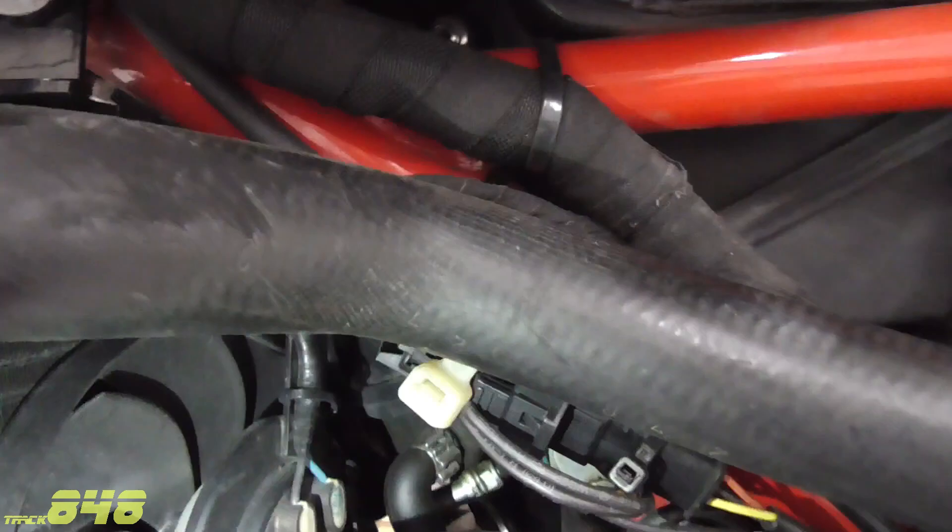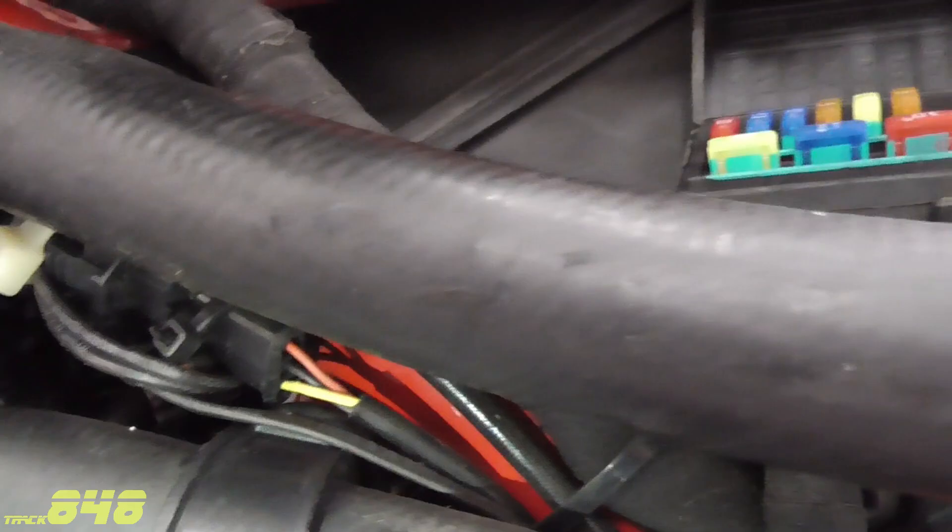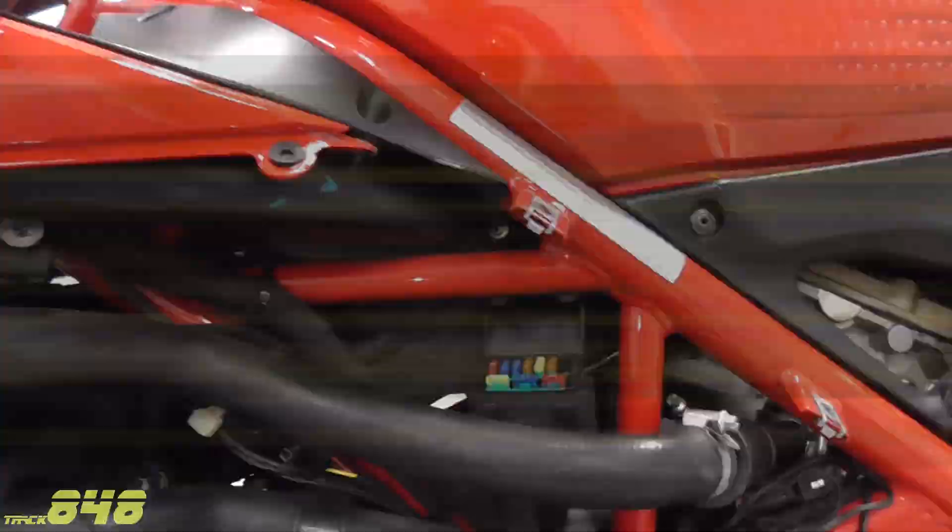Use a flashlight to see if there are any noticeable nicks or cuts in any of the wiring. These wires can be prone to rubbing up against the metal frame or other parts in the motorcycle, and if that happens you could get a short — and that would most likely be your problem. If the problem persists, we would follow up with additional items.